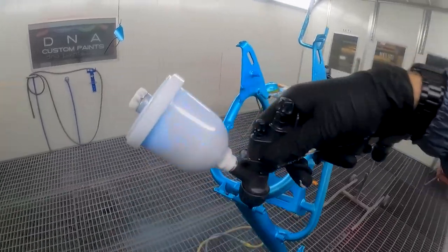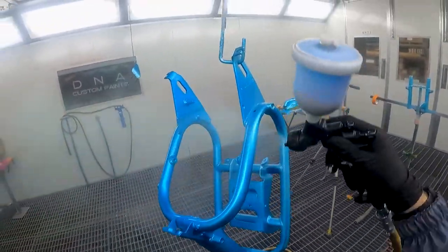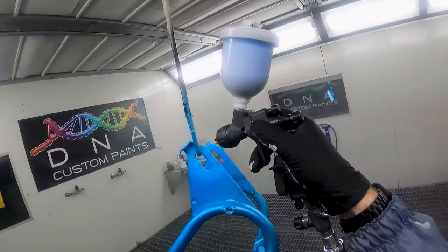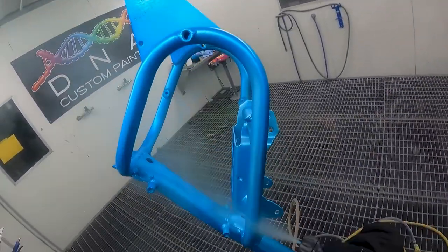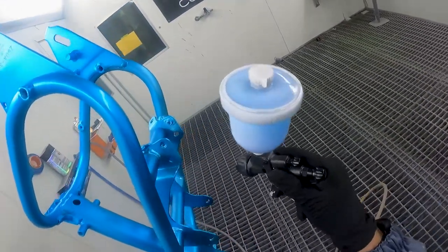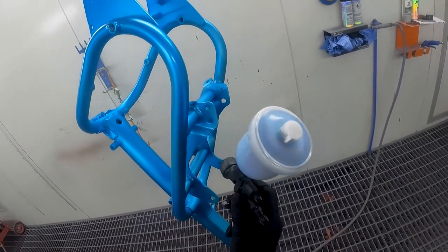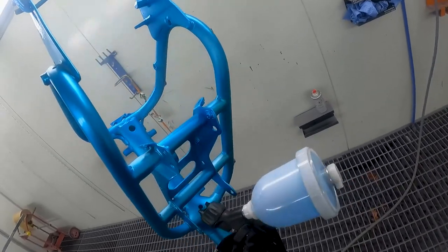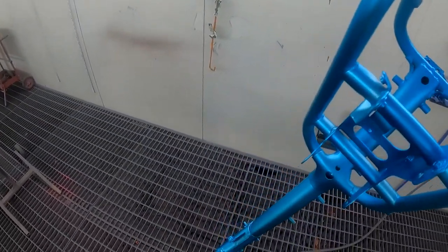Now, especially painting candy. Candy is the most elite color out there. There is no harder color out there to paint. Virtual chrome can be very tricky, but again, that is very easy. There's just a long, lengthy process to paint it. But with candies, if you apply more candy in one area than the other, it's going to be much darker than the rest of the item that you're painting. So putting candy down as even as possible is key to getting a nice candy paint job.